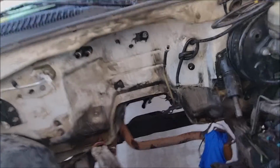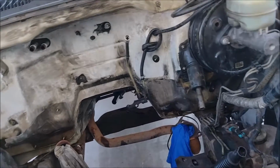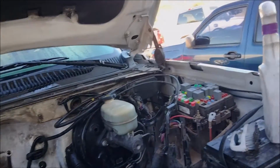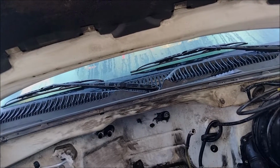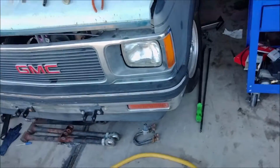So that's where I'm at. I noticed, my brother brought it up here, that the plastic fittings were leaking, so those won't go back on. I normally just clamp the hose right to the heater core because I know they did it for assembly, but I've done swaps, plugged them in, heard it click, and then had the thing pop back off. So I stopped using them. Well, I'm going to get busy cleaning. I had to go buy a pressure washer yesterday because I got an engine job after this too, and I'm sure it's going to be dirty, filthy, grungy.